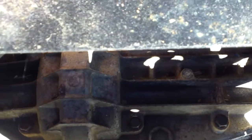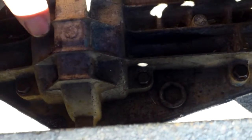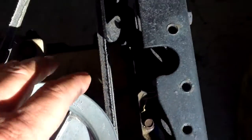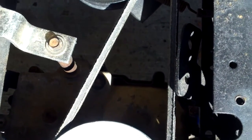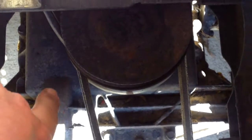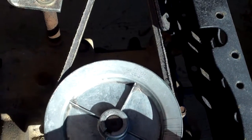Out here looking at the ten-wheeler, or the Murray Gator. You can look inside and see this is a five-speed transaxle — the outer cover is the exact same, it has the ribbings across the top. This was actually a six-speed and I swapped out — let's call them chunks — I swapped out the six-speed chunk for the five-speed chunk. The ribbing on this transaxle is the same. I wanted both of these to mesh up because the five and the six-speed are geared differently — the first gear in both of them is different, so I swapped it out.